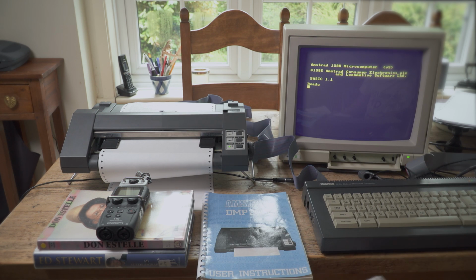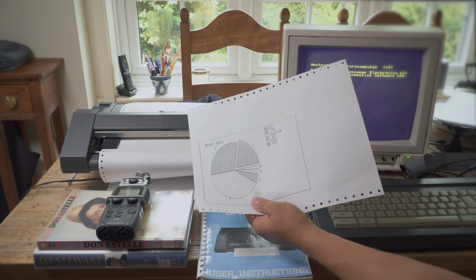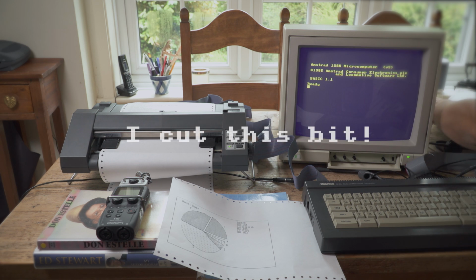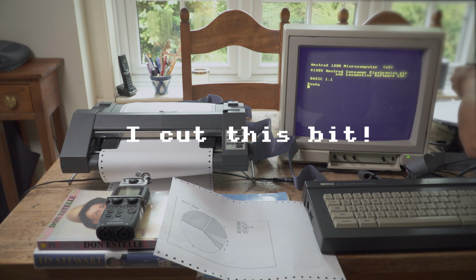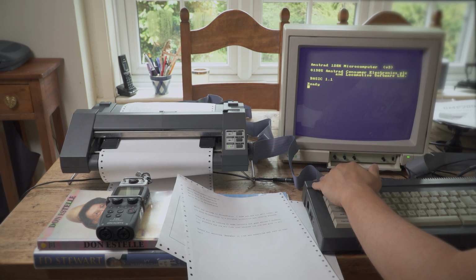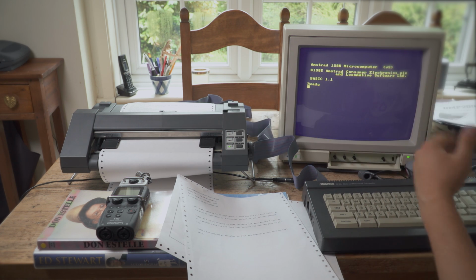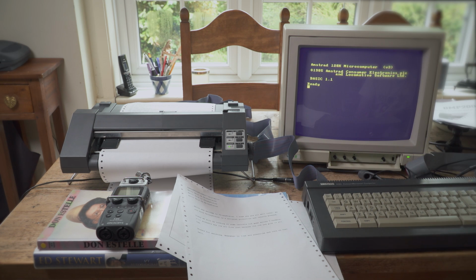So that's a quick look at the Amstrad DMP 2000 printer. It's good for things like this, printing out your schoolwork, charts and stuff. And it was very, very cheap. I'm sorry I've not been able to do the full demonstrations today. Clearly the screen dump went horribly wrong, and we've got double spacing on our other stuff. That's just a function of the fact the CPC here has a 7-bit printer port. The DMP 2000 is an 8-bit standard interface. It's just the CPC has 7-bit for whatever reason Amstrad decided.